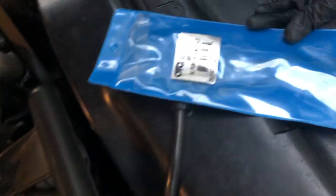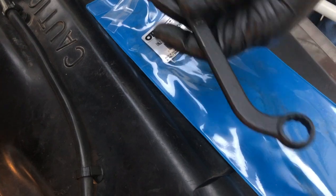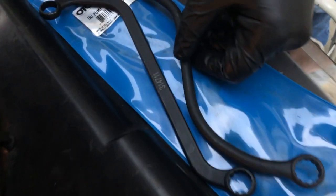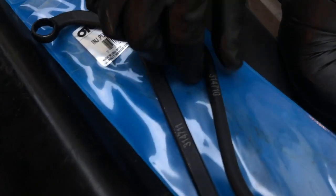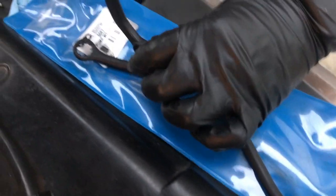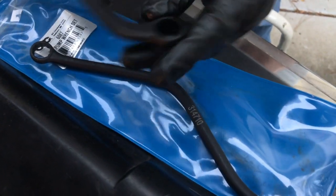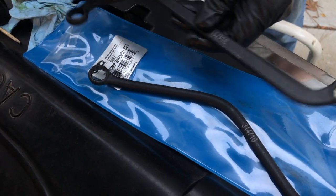There's also a set of tools — this one's OTC part number 6087, which I'll put in the description. There are two wrenches in the kit that cover a range of years for the 6.5, and between these two tools you have the ability to fish down and loosen the nut on the lower passenger side and then the one on the driver's side. Between these two tools you can loosen all three of those fasteners.